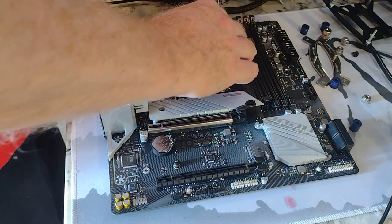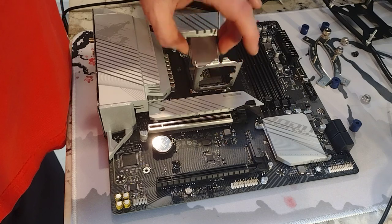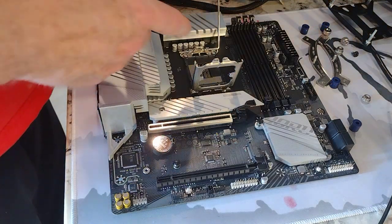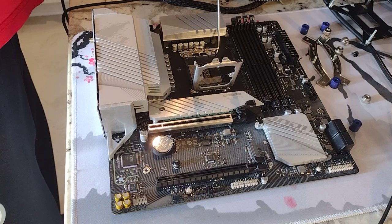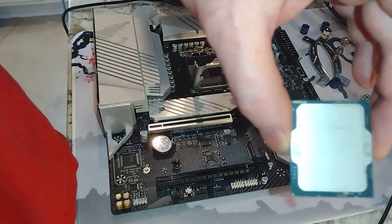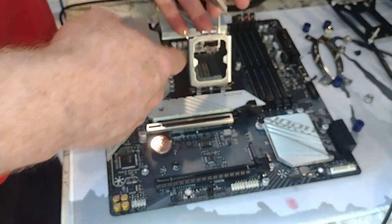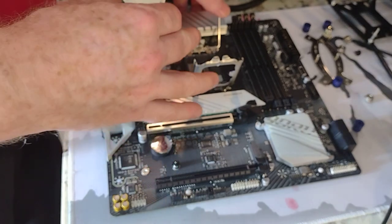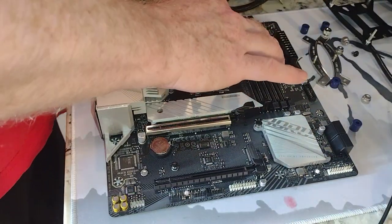Let's go ahead and take this CPU out. As I pull this out, I want to get it out and get the new one in as quickly as I can. Whenever you leave the pins exposed like that, you risk them being damaged. So if I was going to take my time doing this, I would put the black cover back on it. Now even though we've got quite a bit of light, there is the i3-13100F — there's a little triangle here that aligns with the socket.